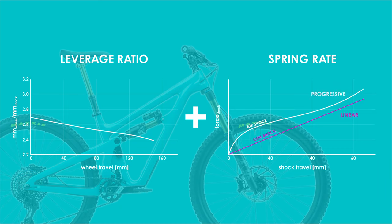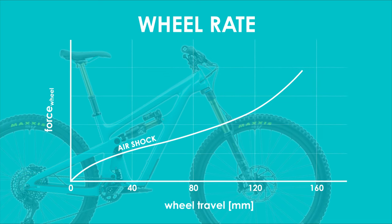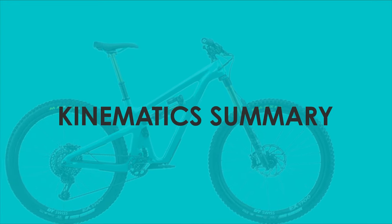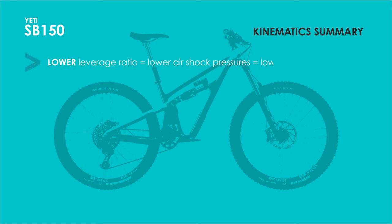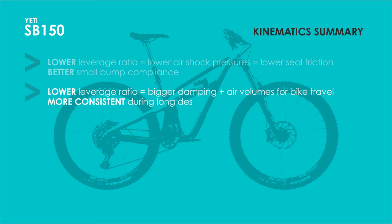It also means that unless you get a progressive coil spring, I personally would not recommend putting a coil shock in this bike. Combining the leverage ratio due to the frame design with the spring rate of the shock results in an overall suspension wheel rate that looks like this for an air shock. If we compare this curve with a scaled curve from the Scott Ransom, you're able to see the linear versus progressive leverage ratio difference — not huge, but present. My overall conclusion with the SB150's kinematics is that I'm a huge fan, at least with an air shock. The lower leverage ratio allows one to run lower pressures in the air shock, which will slightly improve the initial stroke sensitivity and small bump compliance due to lower seal friction. The lower leverage ratio also means that the shock is likely to be more consistent during long descents, as the shock is slightly larger, resulting in larger damping and air volumes, which are generally slower to heat up and change the characteristics. Additionally, having a more linear leverage ratio allows one more flexibility to tune your rear shock to be more or less progressive, depending on what you enjoy riding. If the frame is very progressive to begin with, then one is limited in how many volume spacers one can add to the shock.